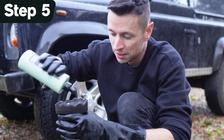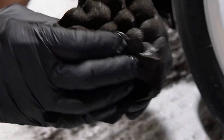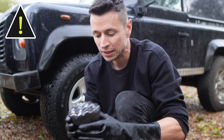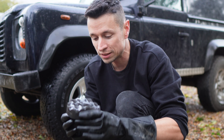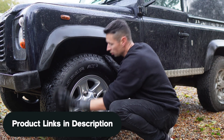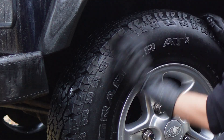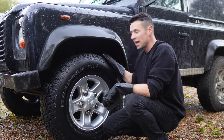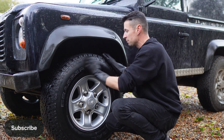Take your applicator pad, put three to four blobs of your tyre dressing of choice on it, and basically you've got to prime the pad. It's a bit like when you put a roller on a wall when decorating — you want to make sure there's enough paint in the roller or it goes patchy, and it's the same story with this. The thing I love about tyre conditioners over your traditional dressings is the way that you can layer it up about 10 minutes after the first coat, because it penetrates into the pores of the rubber and gives you a nicer finish, and you don't get any of that nasty sling which you might get with gel-based formulas. I absolutely love it and I do recommend you try this one out.